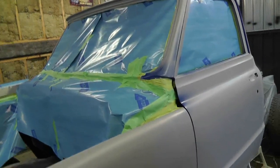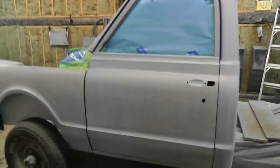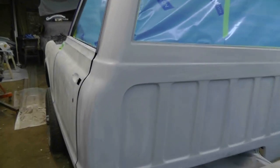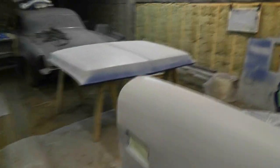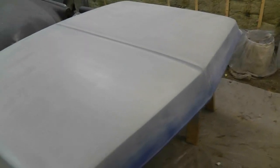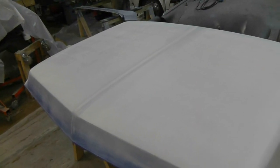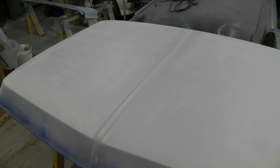Okay, so I'm knocking off for the night — obviously no base on this thing. What I did was go over everything and give everything a sand with 400 grit. Tomorrow morning I will come out and wax and grease remove everything, because my neighbor came over and I couldn't convince him of the merits of not touching freshly waxed and grease-removed stuff. That'll sit for probably half an hour to an hour, then this thing will be getting base in the morning and clear in the afternoon. It's going to be a bit rainy tomorrow so hopefully humidity won't be a problem. Looking forward to getting some color on this thing. See you guys tomorrow.